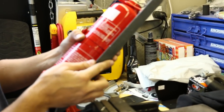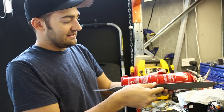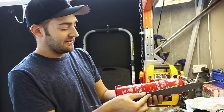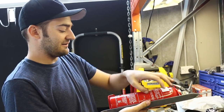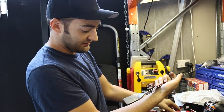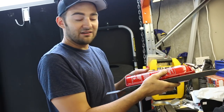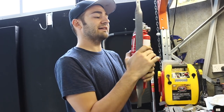I've test-fitted this to the car. I've bent it up by putting it in the vice and grabbing some multi-grips and twisting it. This stuff is quite thin and fairly easy to do, but it's strong enough to hold the extinguisher. That bolts up against the seat, the extinguisher hangs off the front of it, and when you need to grab it, you just flick it off and pull the extinguisher out. I'm going to drill the second hole, check it's bent the right way, test-fit it, make sure the seat slides, and then bolt it to the bracket.